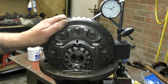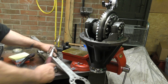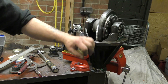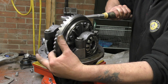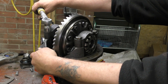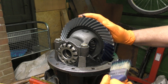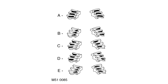That's getting less — I could actually say that's acceptable. What I did was use a 4B tool, bolted it onto the flange, and then clamped it to the vice so it was completely solid. So what we've got to do is another test. For the final time, we're going to torque these down to 90 newton metres, each one of the caps, and hope it doesn't distort the bearing race like we had before. What we have here is the diff, which we can now check for tooth engagement. There is a chart in the workshop manual which will tell you whether your pinion's too high or whether it's too low.